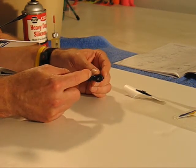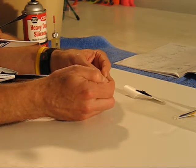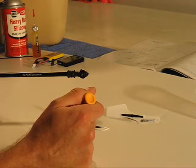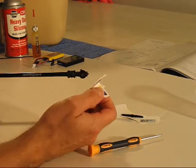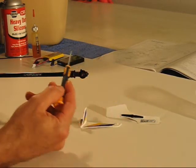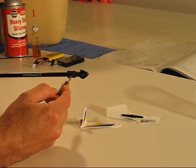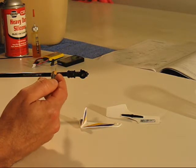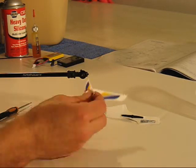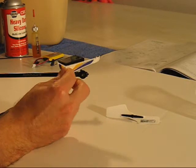Go ahead and put in those four screws in the rectangular pattern, and don't forget the fifth one on the back. Just two more steps to finish up the assembly of the Quark. First, reinstall the tail fin. On the left plastic portion of the tail housing, there's a hole molded in the center. That hole has to line up with the corresponding one in the aluminum tail bone. On the tail assembly there's a pin projecting out — you want that pin to go into those holes.